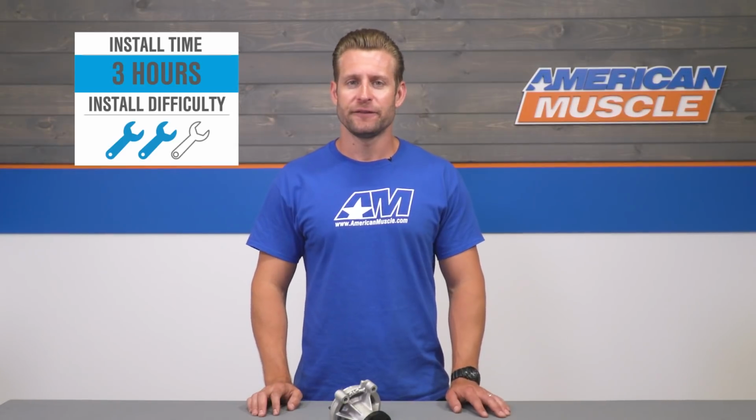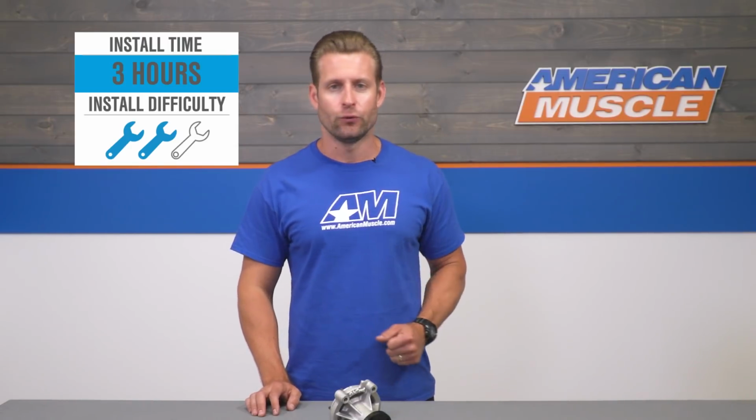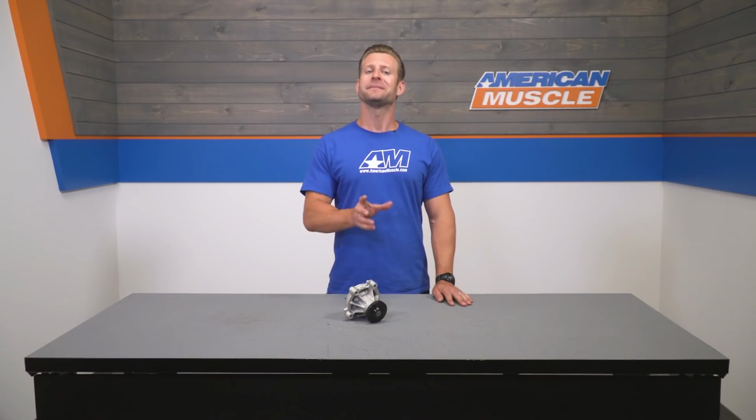Now, as far as your installation is concerned, well, again, the site does call this a 2 out of 3 wrenches on the difficulty meter and roughly a few hours from start to finish to remove that stocker and get the new Edelbrock in place. The pump does not include a new gasket, so just be sure to grab one of those before making the swap, along with making sure to have some fresh coolant to top off after the job.